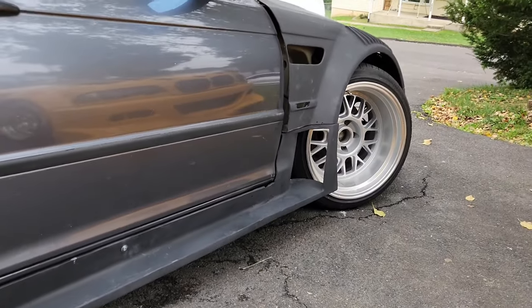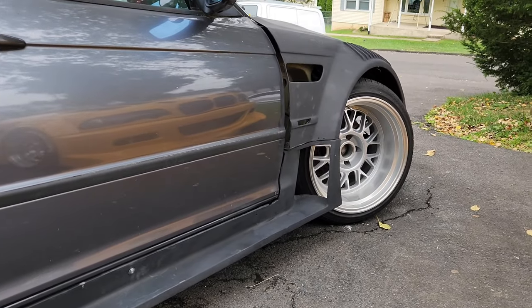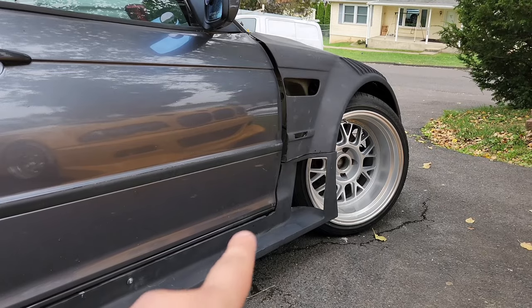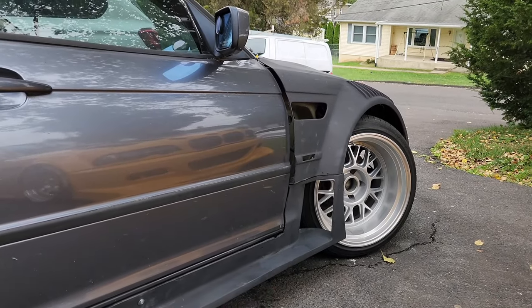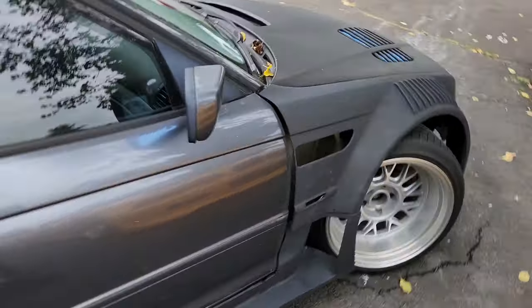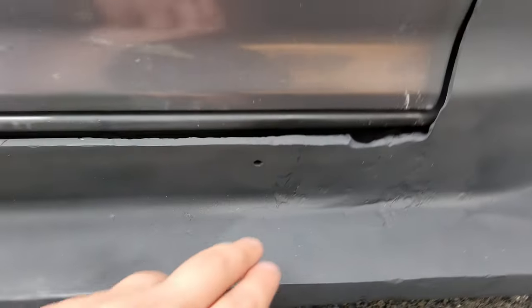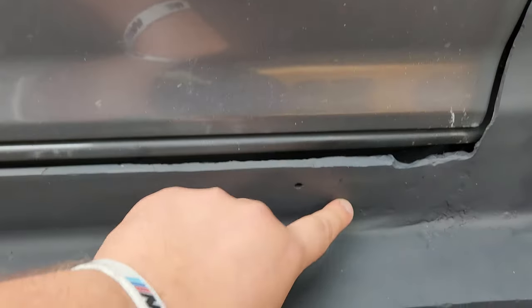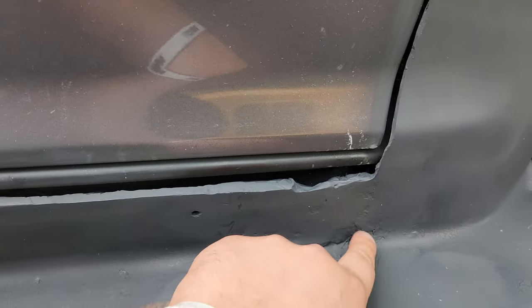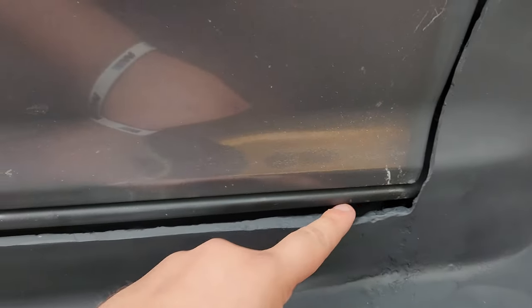It looks good. Now, it's not fully done, but it's molded. Now I just have to patch it up with bondo on top a little bit more, because it has fiberglass bondo on it now, just like this car. But we want it to look exactly like that, like nice and smooth, seamless, like it's never been cut. So we have to sand this down a little bit more, add more bondo to get rid of these little dimples, add bondo right here, sand it down, make it smooth.